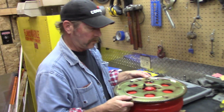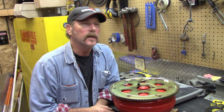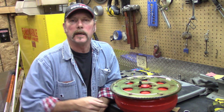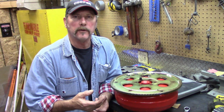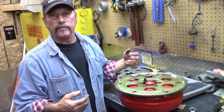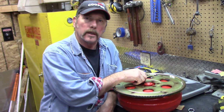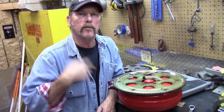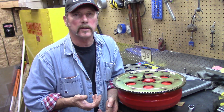This is going to be for a street vehicle. Now, let's say if you had two engines that were exactly the same, one had shaved down counterweights on an engine, it's going to wind up faster. And like a flywheel, you can get a heavy flywheel if you're going to have slicks and it's going to have to really carry the load. You don't want it bogging on its face. And then between gears, as it's shifting, the heavier flywheel is going to have more rotating mass. And you got your pros and cons depending on what type of engine you have.